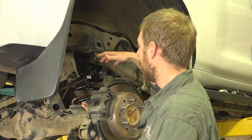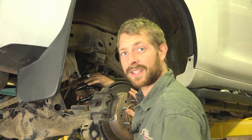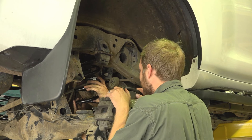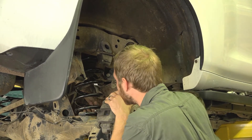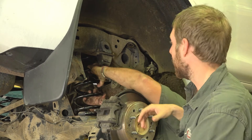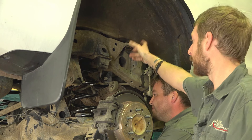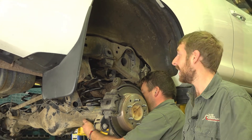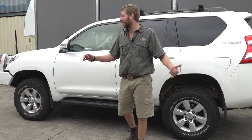The rear of the vehicle — once you release the shock, the diff can come down and we rest it up on the diff stands. We're just about to get the coil spring in. With a decent tug it lines up and fits into place. After this we're basically just fitting the last shock absorber on this end, doing up all the nuts and bolts, and then the suspension should be done.